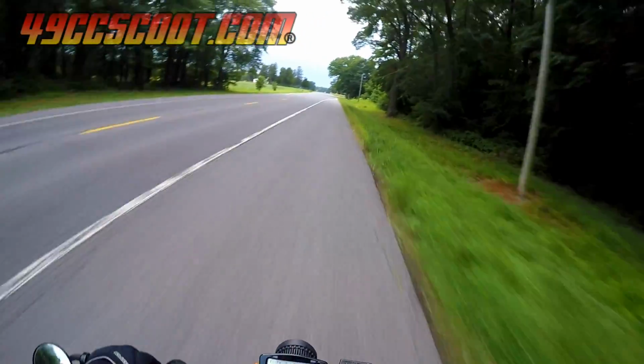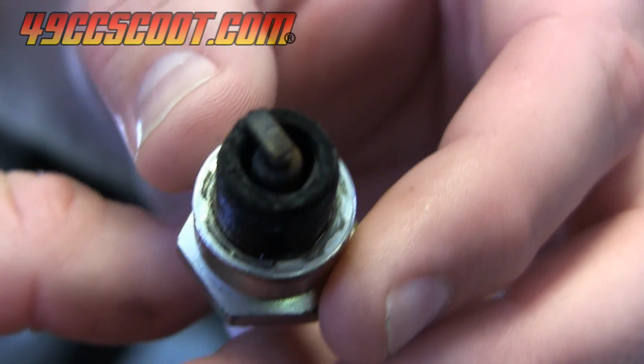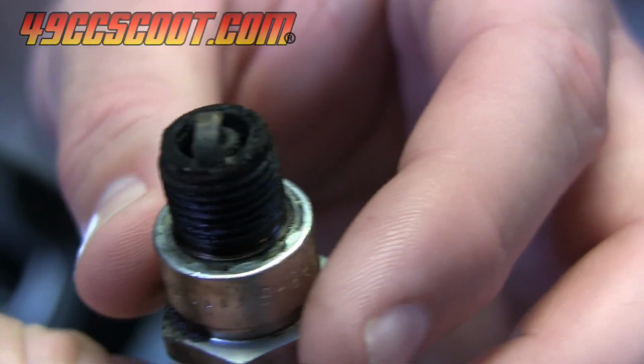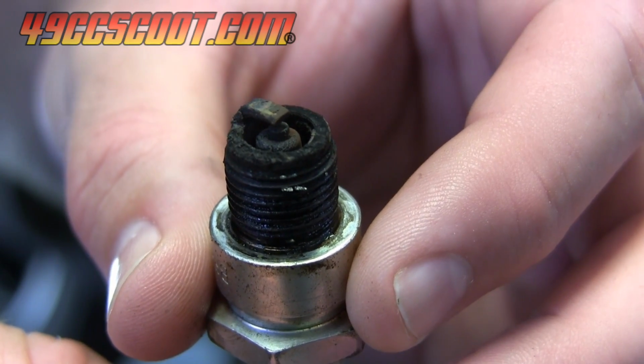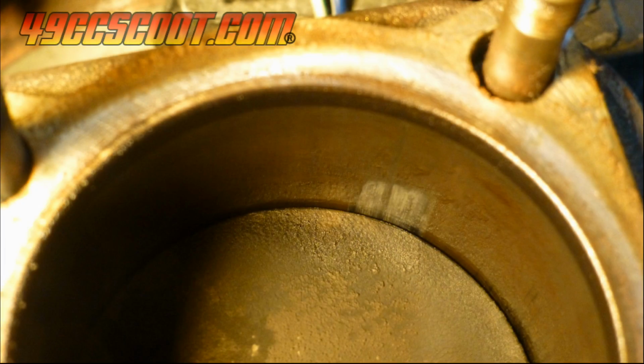You can see in some of my past videos that I keep having engine problems at wide open throttle on these long rides. Luckily I didn't put a hole in the piston this time, it just looks like it's soft seized and it doesn't appear that it was running lean. I've found possible causes in some cases of failures, but it's happened so much that I think it's just a bad idea for me to try to travel great distances at full tilt on these air-cooled setups.